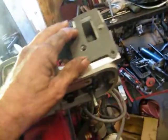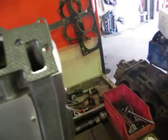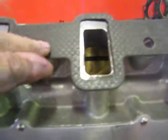The problem with the ports is, I've got a gasket here, put it on the head. Lines up very well with the head, standard BN gasket. Pretty happy with that. But when I put it on the manifold, not very good. Two ports line up okay. A little bit of work, but fine, which is expected. Actually very good on the two first ports.